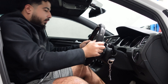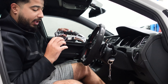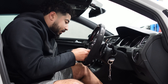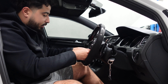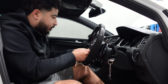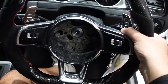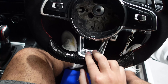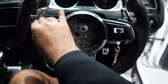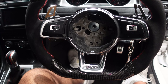Next, connect the plugs back again. There are two plugs you need to make sure go in first — you should hear a click once they're seated. You can do this however you feel comfortable; personally I prefer top down, as it's easier when you've taken it off that way. Because it's an OEM steering wheel, everything clicks into place nicely. This wheel is a little thicker so you'll need some finesse to get it back in, but it's really not that bad.